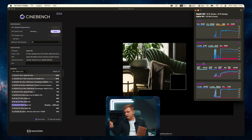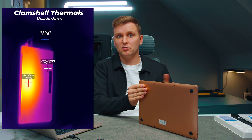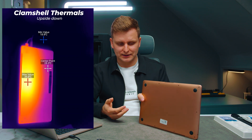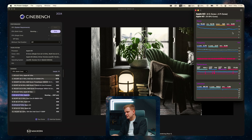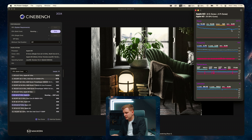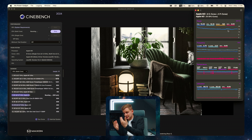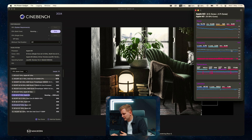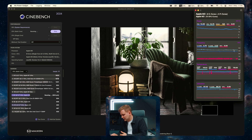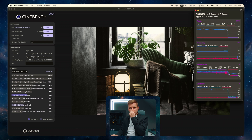You can see the package is slightly going down towards 17 and 16 watts. So if you're using your MacBook in a dock situation — editing photos or something like that — it would be especially beneficial to have the thermal pad in the back so your device runs cooler. All it's going to do is let the device run cooler. You can see that when I lift the laptop and touch the bottom, the wattage actually goes slightly higher because it cools even better. Right now leaving it on the floor, we can see a correlation of slightly higher clock speeds on the graphs. Our test is complete and even at the end we were pulling close to 15 watts.